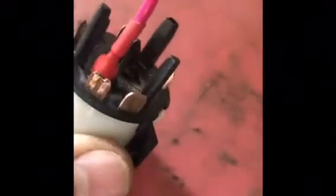So one thing I did check, I opened up the back side, the plastic, of the switch, and determined that it didn't do any damage to the switch itself. Had I opened it up and that was all melted, of course I wouldn't be soldering on a piece of wire as opposed to using a connector there. But I think this will resolve the problem of the loose connection and overheating. I've got the heat shrink over my soldered connection.